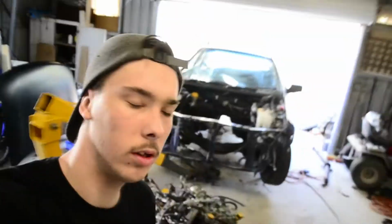We got the engine out last night out of the Subaru. What have we got to do today? We're stripping the boot, all the interior pieces out of the boot. What else? Oh yeah, I want to get rid of all the stuff under the dash, and the rear left drum brake has jammed on, and I need to get to the adjuster screw and wind back the drum so it can be moved around. But yeah, that's what we're going to do now.